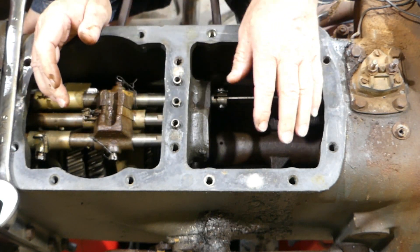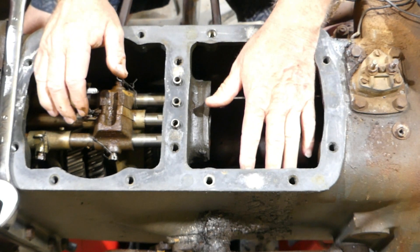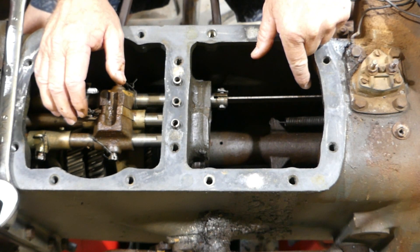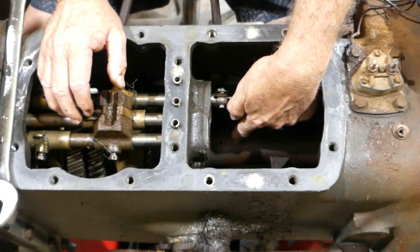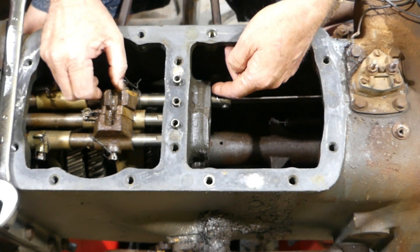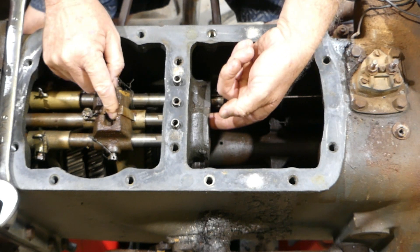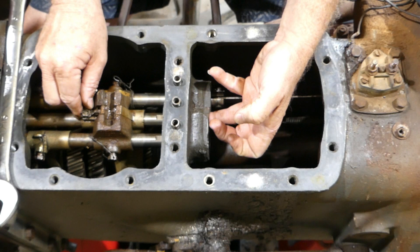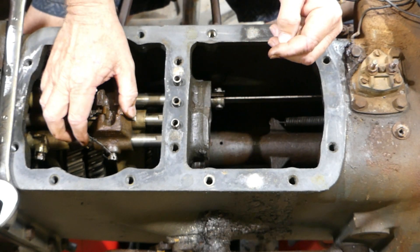Oil from the gearbox sits in here. This is an open cavity where your clutch is — your throw-out bearing is in here — and this should be a dry cavity. If you have oil coming out of your tell-tale hole down the bottom of your bell housing, it can be your rear engine seal, it can be the front seal on your gearbox attached to this fella here — that's where your main shaft goes in. It can be this seal around this shaft here; there's actually a lip seal around there. And there's two Welsh plugs on the front of these selectors. The selectors have little flats on them normally, so when you bring the gear selector up forward, you don't get an airlock up in the end there.